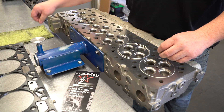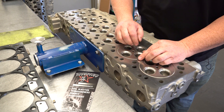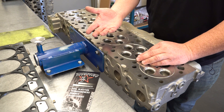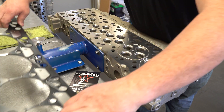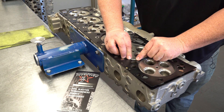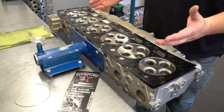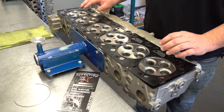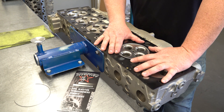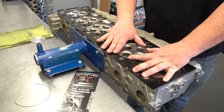On a piano wire slash O-ring, you have a basic O-ring in a groove that protrudes 7 to 10 thousandths, and the actual gasket sits on it and smashes into the gasket. Which is better? It depends on who's doing it and what experience they've had. We've had tremendous good luck with the fire ring style, and I would say 60 to 70 percent of machine shops out there follow this procedure.